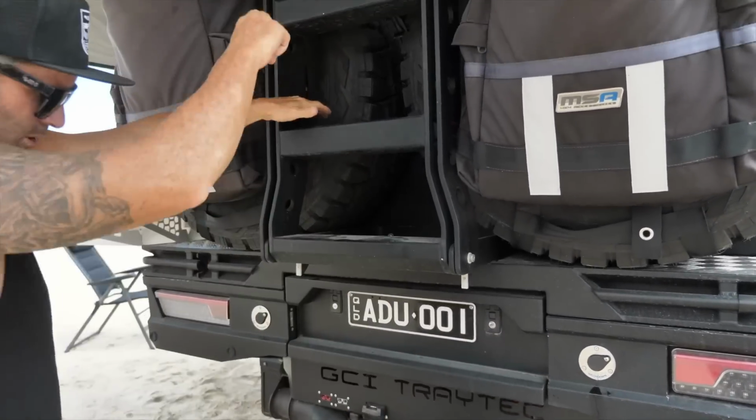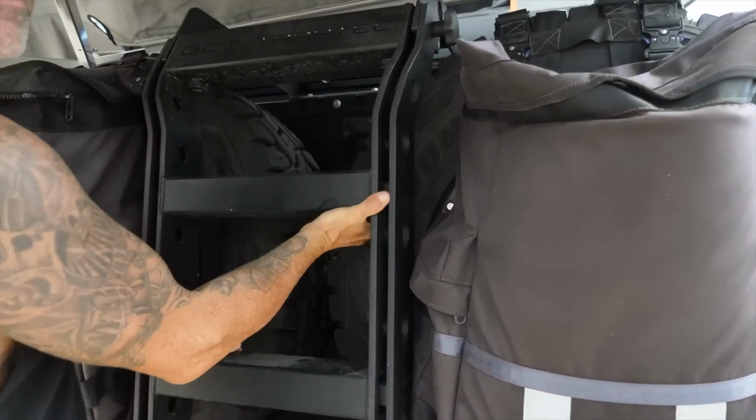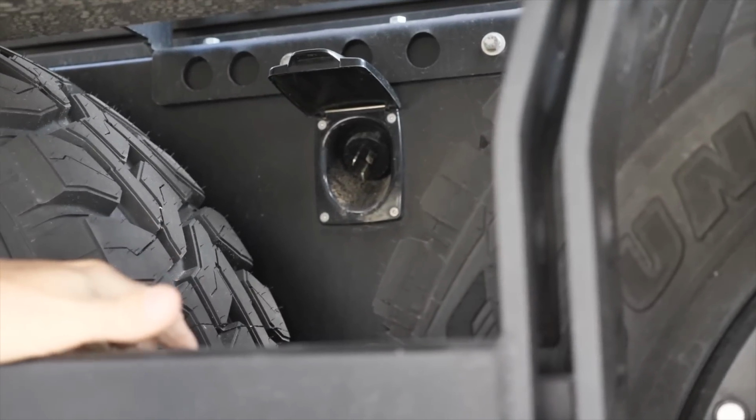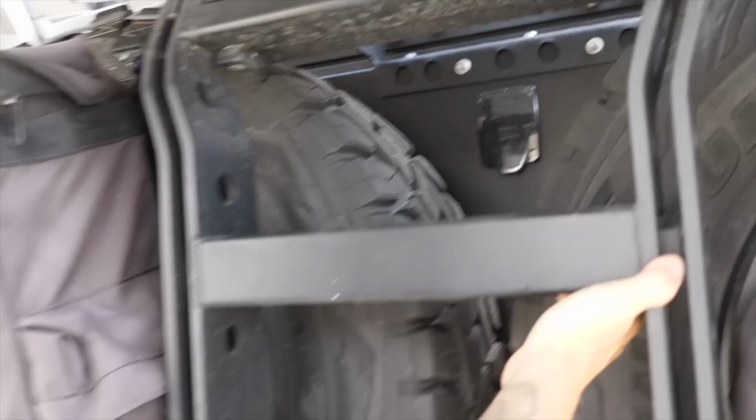Oh, okay. Up here we have shore power. So if I'm ever plugged in and I need to plug into 240 to charge the canopy, that's what I do. We don't, because we have the rooftop tent up on top, and I used to carry my surfboards and all that, I never put a solar panel on top, so we have no solar charging this. It all relies off the DC to DC charger. Or if it ever gets super low anyway, I'll just shore power it into our caravan, because our caravan has a huge lithium system as well, and charge it up from there. If I was to do it again, oh no, I still wouldn't put solar on the roof, because if we're going to modify this truck, I'm putting a boat on top anyway.